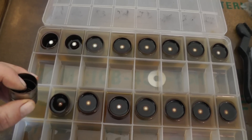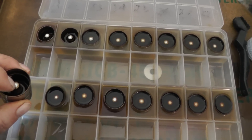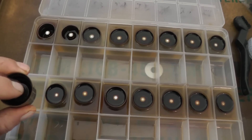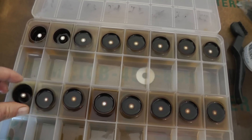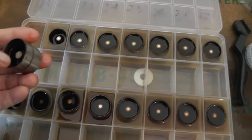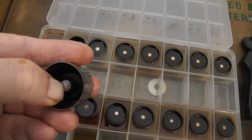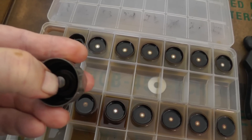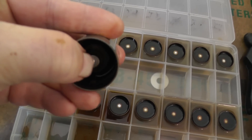So the recommendation is to bleed some of this oil out. You do that by putting the lifter in a vise — I'll show you that later. You push down on this inner piston, there's a spring in here and a check ball. I've done pretty much all of them. I'm going to take this out in the light so you can see it a little better — you can see this one here is going right on down.